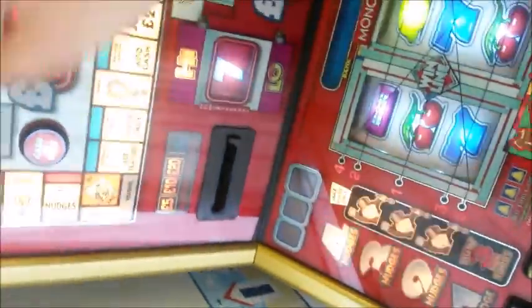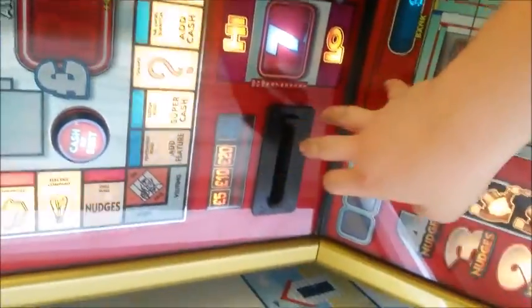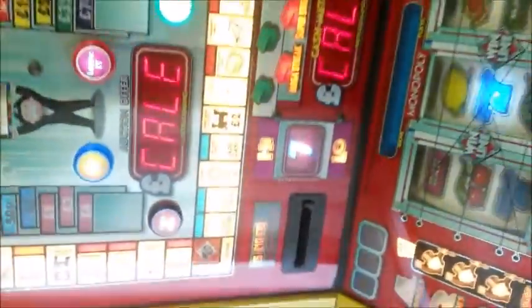You can do this if you just bought the note reader off someone on eBay, or you got it from a company, do that anyway. Reset that BNV key on the note reader so it will communicate with your game better. Enter the BNV key, as long as it says valid, test it, shut your door, bingo. If you still have issues, your game is faulty and it will not accept a note reader whatsoever.